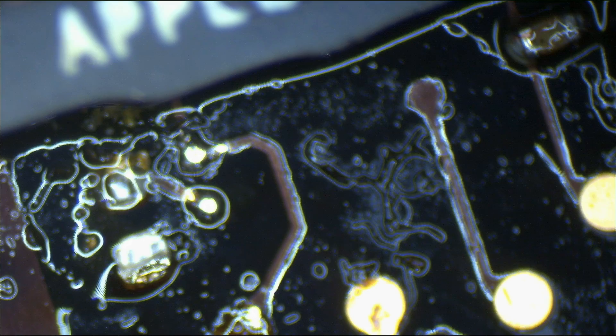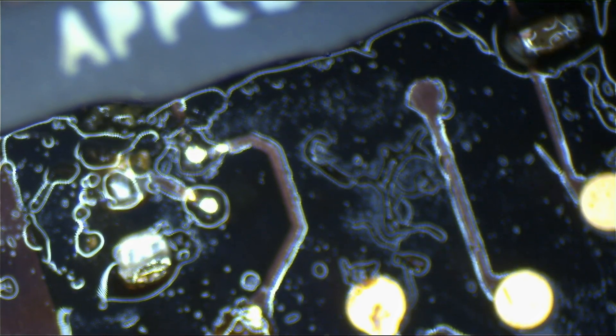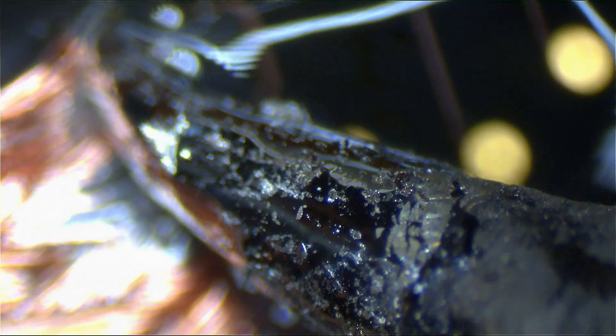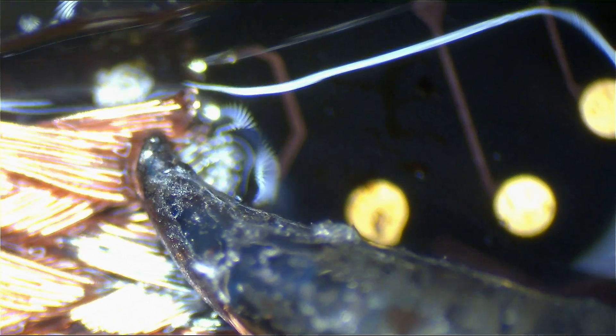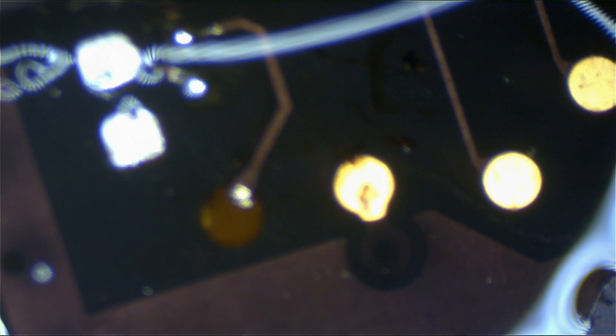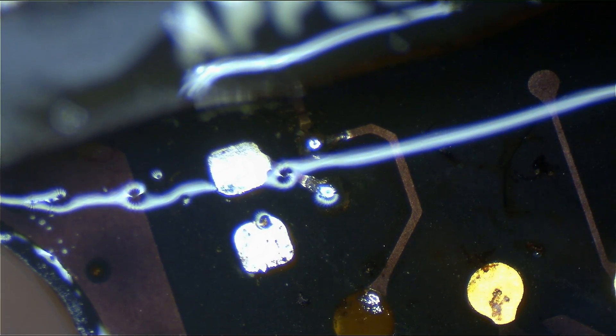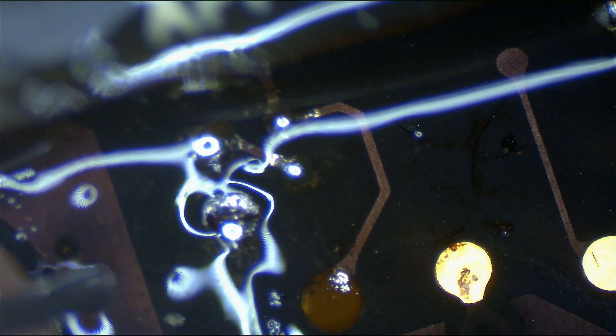The capacitor itself is probably fine — that's cosmetic damage, a little bit of wear and tear. If they don't spill something again, that cap probably could have been reused; this is just me being a bit OCD. Keep in mind that probe point on the bottom that is destroyed — it doesn't actually matter. That's a test point, not going to anything functional. Looking at the schematic: SMC_lid_R goes from the resistor through to the other side where it becomes SMC_lid, then goes to the capacitor, and from that capacitor it goes to the SMC. The probe point before the resistor wouldn't go to the SMC anyway, so it's pretty much worthless.